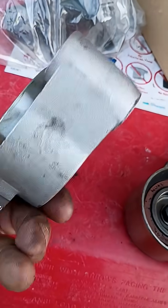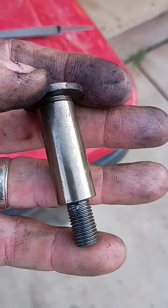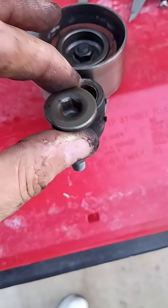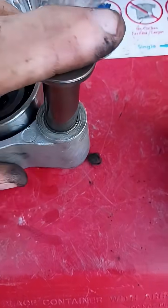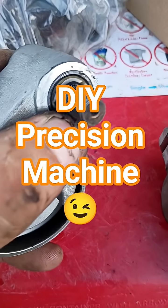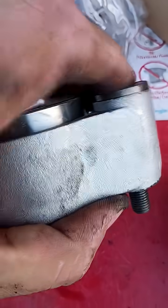Toyota timing belt dilemma. This is my brand new tensioner pulley, and this is the original one. Let me show you what the problem is. This shoulder bolt holds that pulley tight to the block, not completely tight because it pivots on those two bushings there, and this tensioner gives us the point to ride. But the new Chinesium one, when you tighten this bolt down, because it is 25 thousandths too thick, this housing tightens against the block, and this bolt stops this thing from pivoting easily.